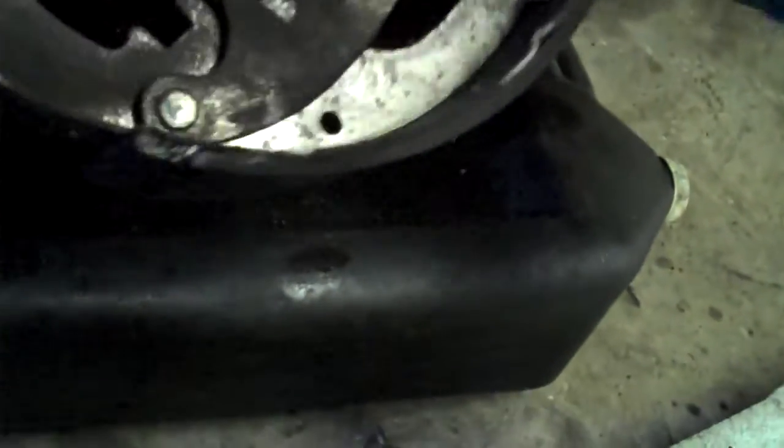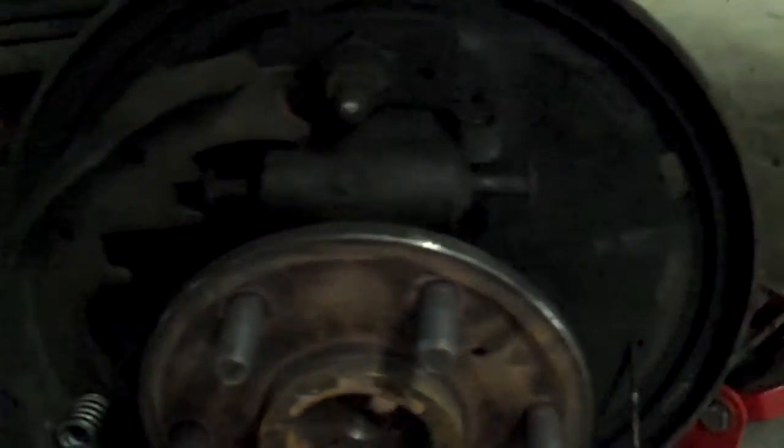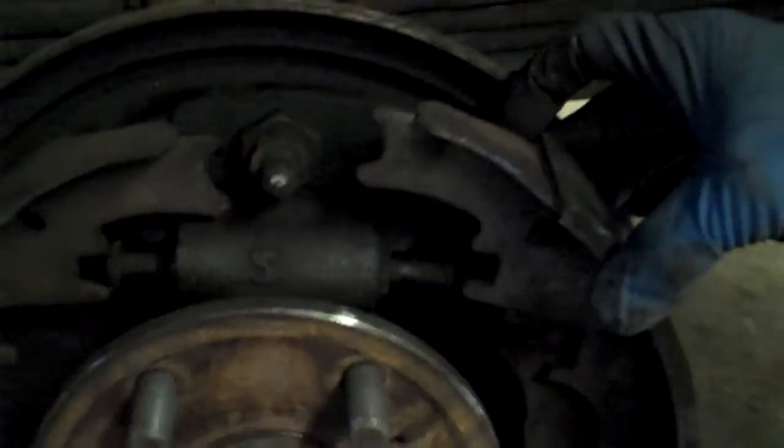This spring was holding in the side, and because I looked beforehand I'll be able to duplicate that. There's a little horseshoe clip thing — I want to clip that together on the new pad. The other thing you want to pay attention to on these drum brakes is on the lead brake — see how we run out of pad material? On the back shoe, the one toward the back of the car, you're going to have a full shoe all the way. On the other one, it's going to cut short, and you want it to be that way. So when you line up your brakes and clip this thing in, make sure you clip it in behind one that's going to have material all the way back.